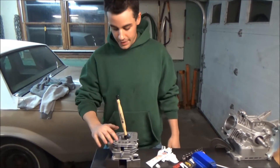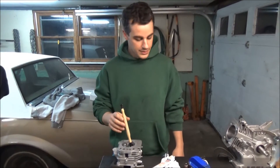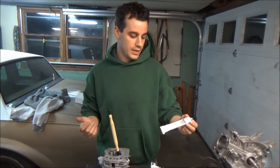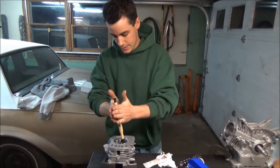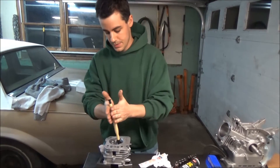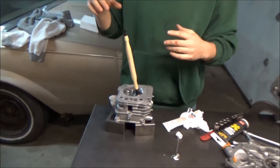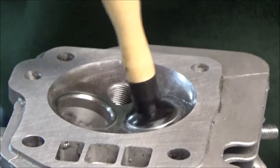My head I already sanded down — I like the finish on it, I think it's pretty good. All else we have to do on these heads to get them ready, since we did the porting and polishing, is just lap the valves. I have brand new stainless steel valves and this was a brand new engine. I just picked up your basic valve grinding compound at the local auto parts store. You can also get the lapping tool at the store — it's got a suction cup. You have to clean the face of the valve real good, maybe spray a little WD-40 to make the suction cup stick. Just dab a little compound around the valve on the seat and you can hear it — it sounds real gritty at first and then when it's getting worked in good it smooths out a lot.